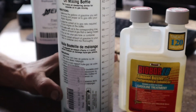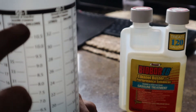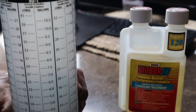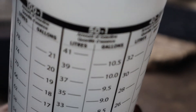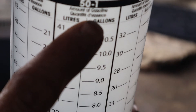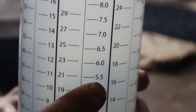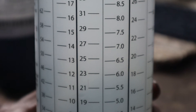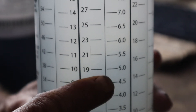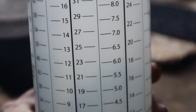You're also going to want an oil mixing bottle. Two-stroke motors are required to run at a 50-to-1 ratio. On the mixing bottle, the six-gallon mark tells me how much oil to add for a full tank. If you're only putting three or four gallons in, you go to the corresponding mark and add that amount with your fuel. That covers the fuel mixing — let's get to fuel selection next.